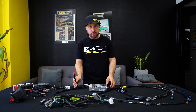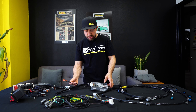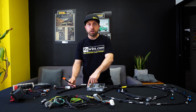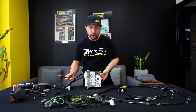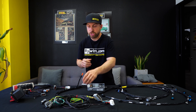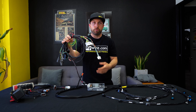One thing I want to point out is that only two plugs out of the three in the computer are plugged into these harnesses — it's going to be the A plug and the B plug. The C and D are for automatic transmissions and these ECUs don't have them; you can see through this cover that they're not populated. The E plug is on the very end, and if you have a DC, EG, or any standard Honda car, you use a chassis-specific adapter or some kind of interface harness for the chassis.